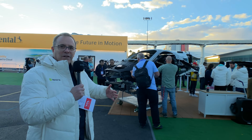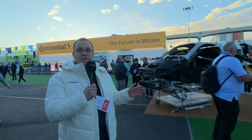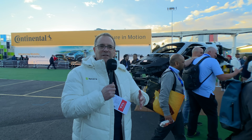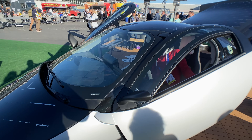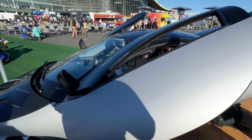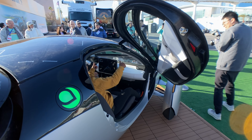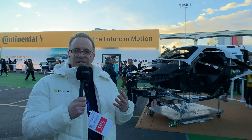Here's the deal. You start with a normal door that opens outward, but the problem is it'll bang into the efficiency we need from the fairing or the wheel pant on the front wheels. So not only does the door open outward, it's going to bang into our aerodynamic elements. What if it opened upward? Where's the best angle to get the door up and out of the way, get good ingress and egress, allow for the fairings to be where they need to be, and add the benefit of being a nice reminder of how special and unique the vehicle is.